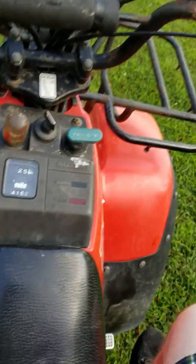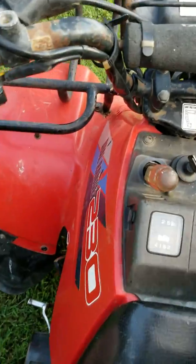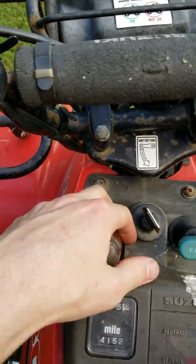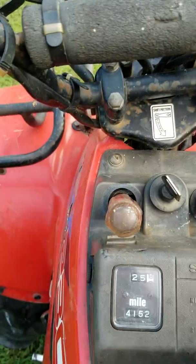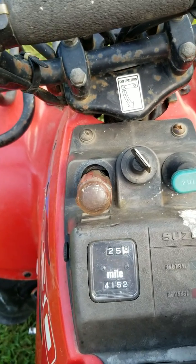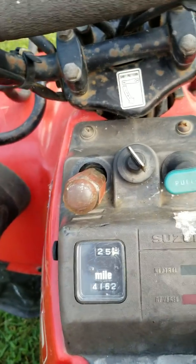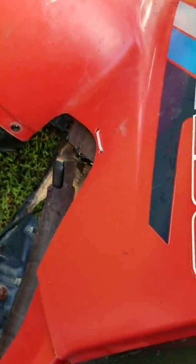Of course it's not going to go in reverse now because the thing's sitting still — it won't hardly shift in reverse if it's not running. But anyway, the thing takes practically zero effort to work. The original handle was just like this but red, and I'd broken it once before and fixed it. It would absolutely make your hand raw trying to work it — the cable was so rusted inside and it was ruined. So yeah, new reverse cable for my crunchy old 30-year-old Suzuki four-wheeler.